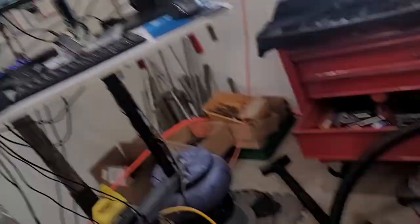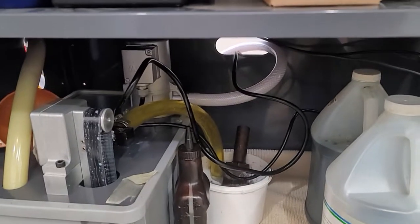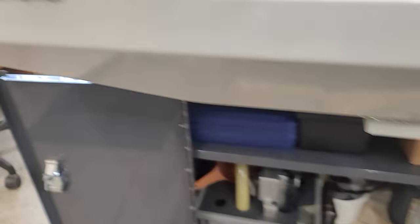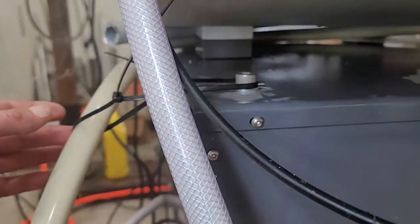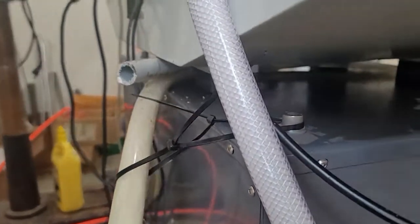What I've done here — you can see the stock pump in the back there, and the coolant line going to it. But this return line here — see how well that coolant's flowing back? It wasn't. What was happening was, see where I've got this pulled up some? Well, this was sagging and was not letting that coolant flow directly back into the pump like it should have been.